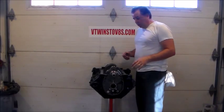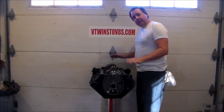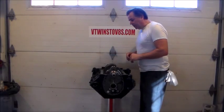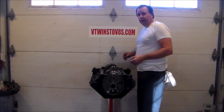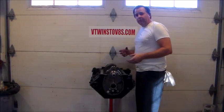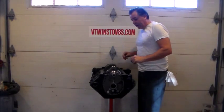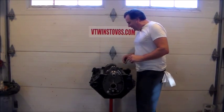I'm going to systematically remove all of these and check them. Everything is at two thousandths which, for a street engine, is good. If you're going to run a high performance race engine, they loosen them up a little bit to two and a half, sometimes even three thousandths. The reason is there's just less break-in period — it's a high-revving engine and they're not looking for longevity, they want quick high RPMs. We're looking to go the long haul here.